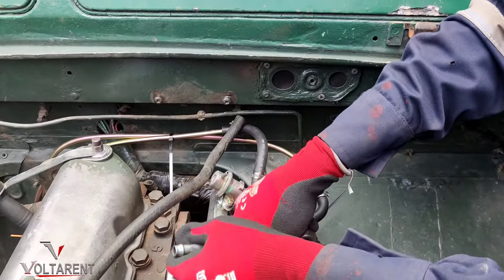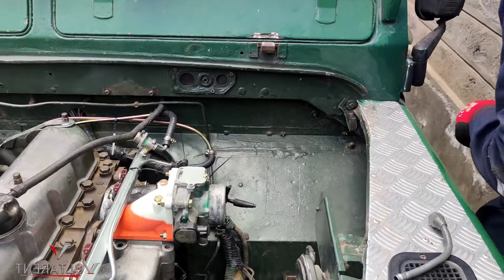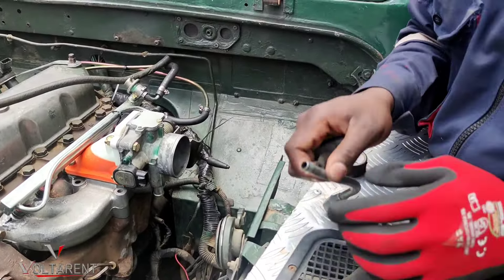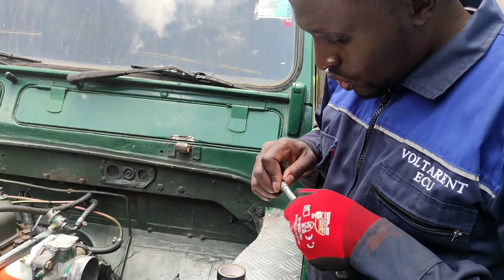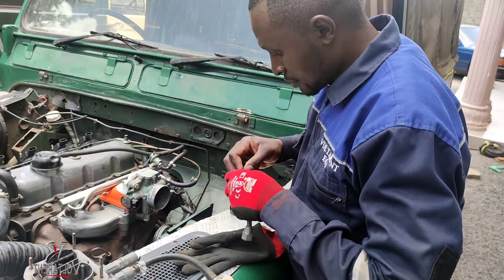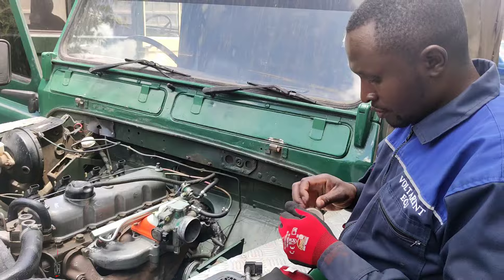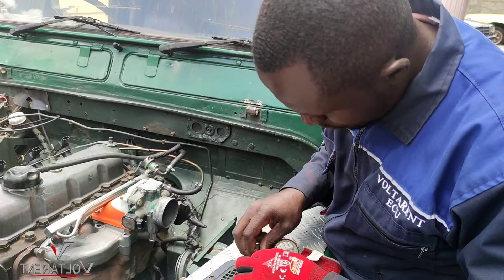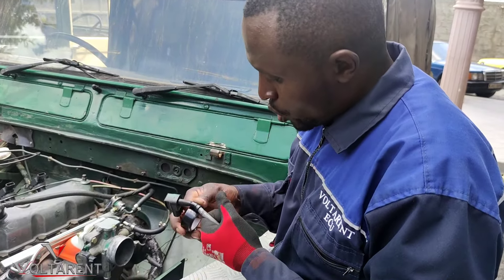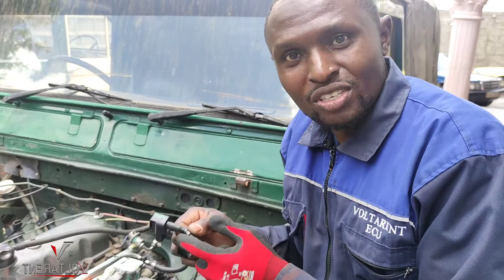This is not connected to the brake booster yet — this is where I'll attach the MAP sensor. I take the MAP sensor and my trusted tip. I need to push this in; the ECU needs to know how loaded the engine is. It's just more or less like a fast tape — temporary. I just want the ECU to know how loaded the engine is, so this is not the final way of doing it, but first I want the engine to start.